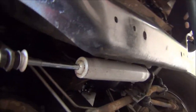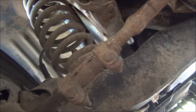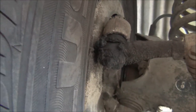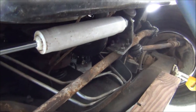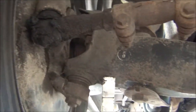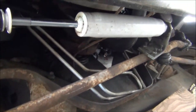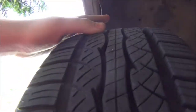I also wanted to see if there was any play in any of the suspension. For those of you who are new, I do have a steering stabilizer on this. I don't really see any movement. I think I'm just going to replace these boots and free these drag links up, so it'll be easy for the guys to align this when I go get it aligned. Because as you can see, this is kind of being chewed away — a little funky. I think the toe is off, otherwise I think the camber is just right.